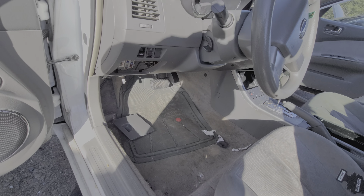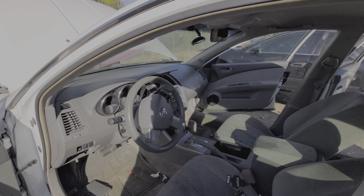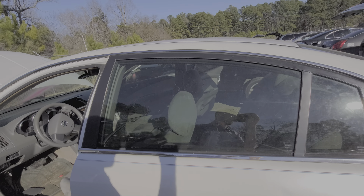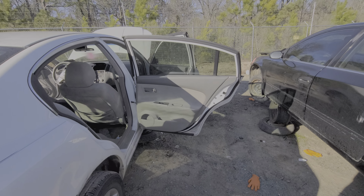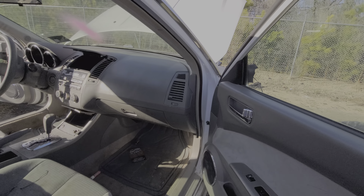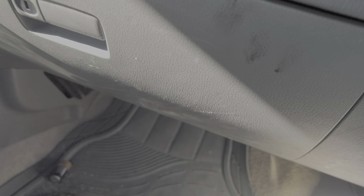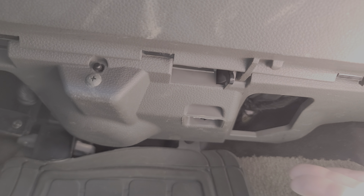As far as the location of the blower motor itself, it's over here on the passenger side. Let's take a quick walk over there and check a few things out. This is what I do after I've checked the fuses — I take a look at where the blower motor is. On this car you can't see the bottom of the blower motor directly as it's behind this cover.